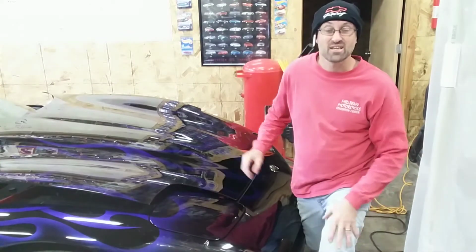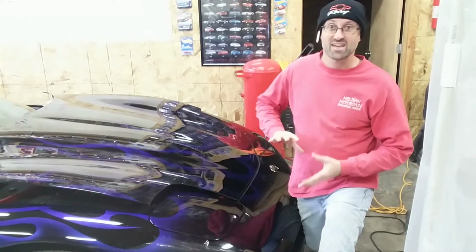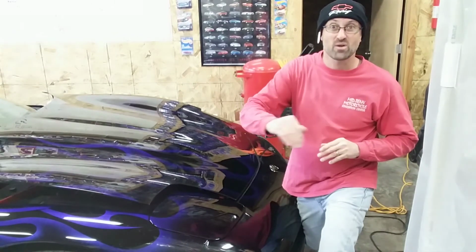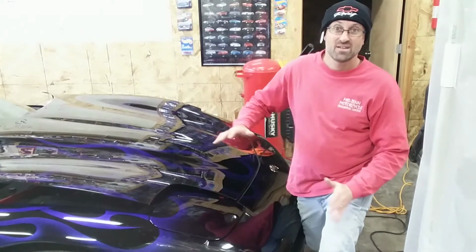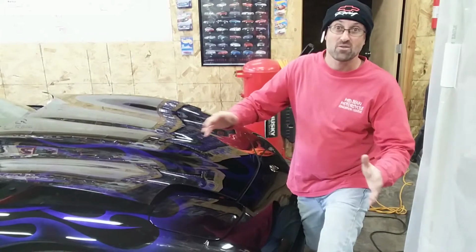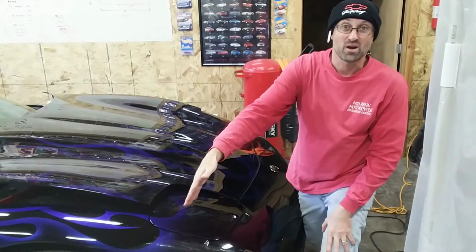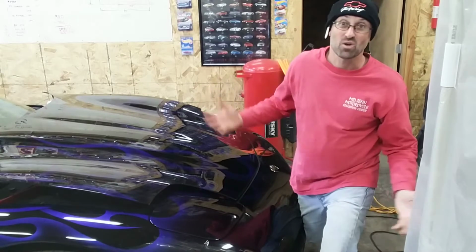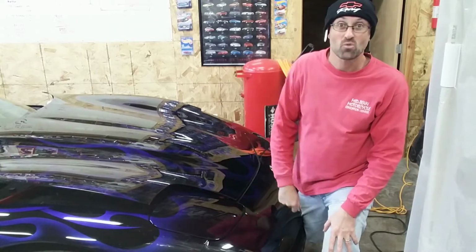film in position really. And then I need to work outwards because this is going to be kind of like a curved shape. I can't just go all the way around the edge because it's going to bunch up on the top. So I've got to work it as it goes on each side. So start at the license plate, work it out, and all the way around to the back edge. Now on the other side, remember I should have about 6 inches on each side, and we're going to give it a shot. So let's get this cleaned, get it wet, and we will start wiping out the water.